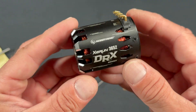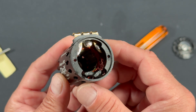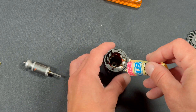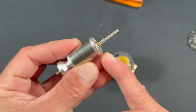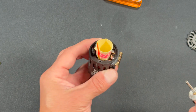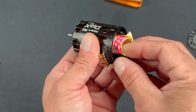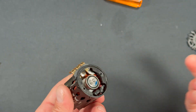I'm going to take a look here at the stator or the can assembly. Good looking everything there — really packed the wires in that guy. For rotor reinstall, the trick is to make yourself a tube out of some material. Try to make it a little taller than the stator and only barely wrap around itself so it doesn't make everything kind of too tight. You slide that down into the stator first, open that guy up. On our shims, you got your wave shim and then your regular shim — wave shim goes towards the rotor, the regular shim goes towards what would be the bearing side. You hold this guy nice and firm, get down in there between your guide, get the front side lined up, and as you let go, it kind of pulls itself in. Give it a little tap there to push it all the way in. Then you can slide your sleeve out and you didn't scratch anything up on the way in.